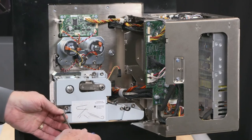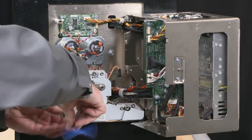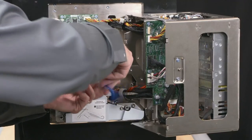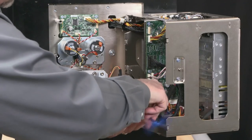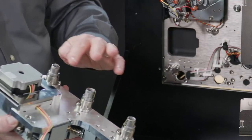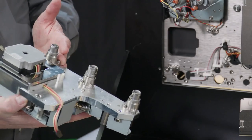There are three screws to loosen. These three screws, just like the screws on the items on the front, are captured — so you're not worried about dropping screws if you're doing this in an environment. That's easily taken out. These three couplings go through the firewall; that's where your platen, pinch, and peel rollers plug into.